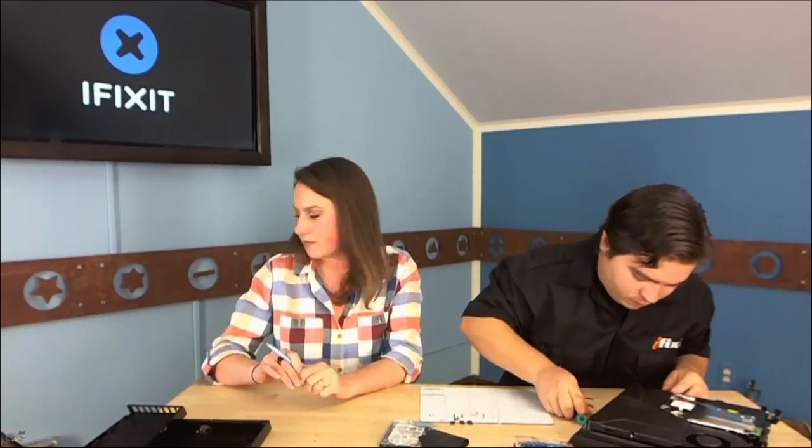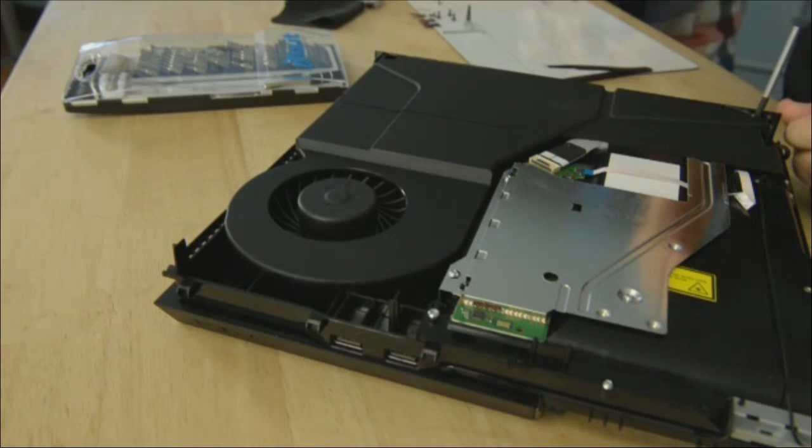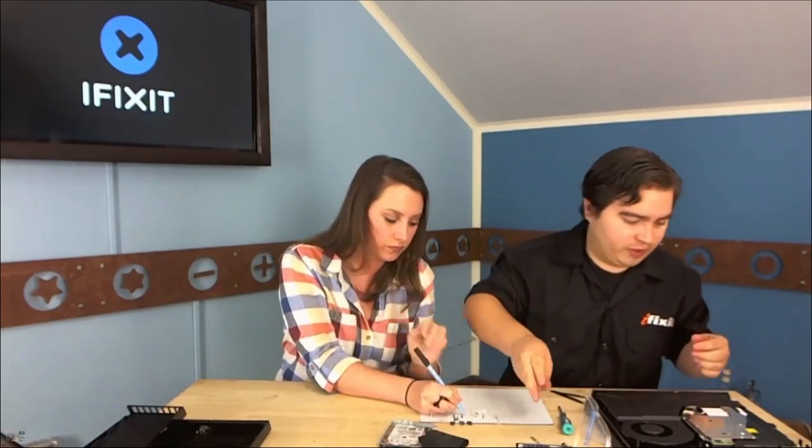This is a design by Sony — the larger the fan blades, the quieter the fan will be. It can rotate slower and still get more air movement, so in a device like this you want a big fan. Did you notice how noisy it was when you started it up? Not at all — very quiet. Compared to the first-generation PlayStation 3, which sounded like a wind turbine! And the original Xbox 360 sounded like a jet airplane about to take off.